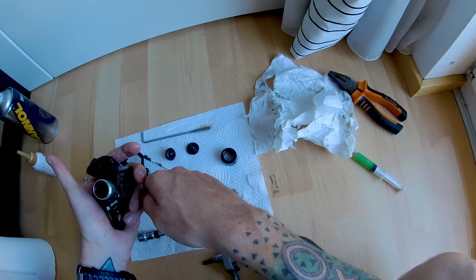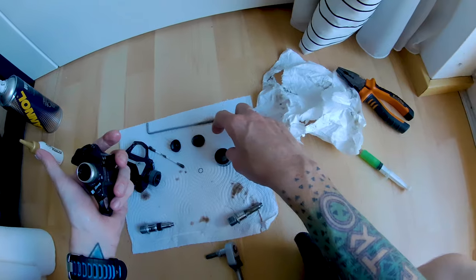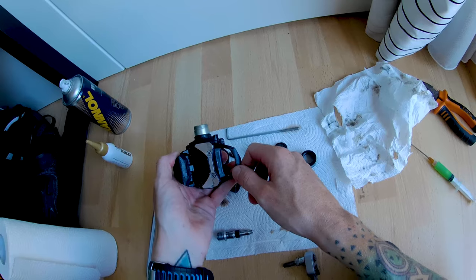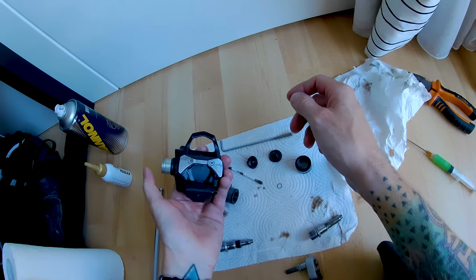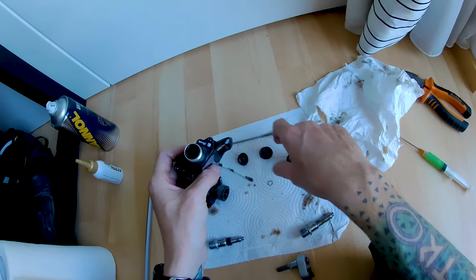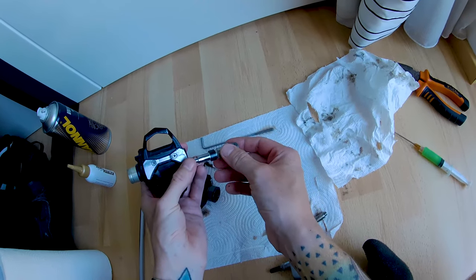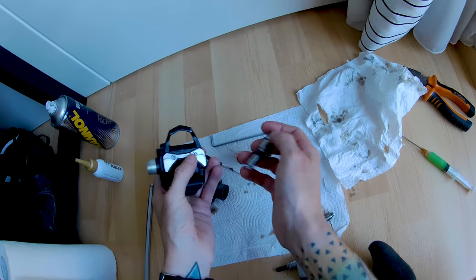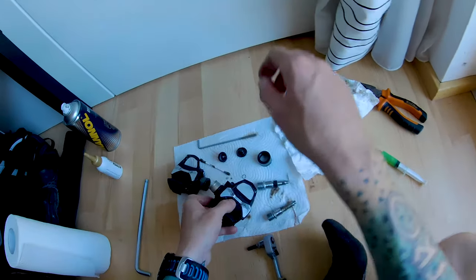It's similar to Apple's tactics — they try to make it so you can't repair them yourself. It's also impossible to request the bearings from the PowerTap Service Center; they will not share any information and will say you have to recalibrate it. I think if you replace this bearing it's a myth that it changes calibration — I think it will stay the same, because the wear we have here influences the power more than replacing this bearing does. But in any case, let's continue.